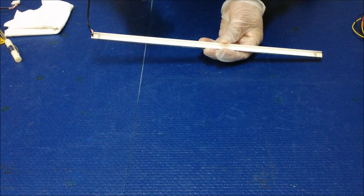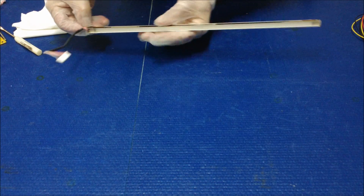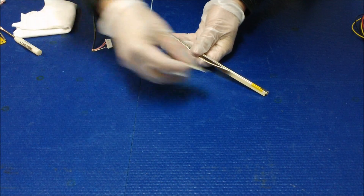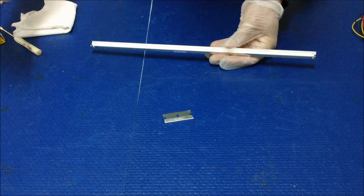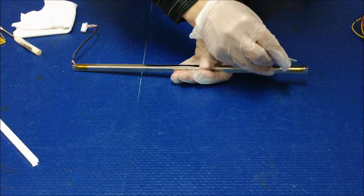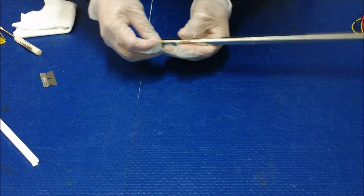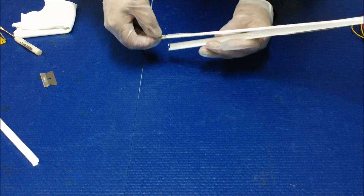We need to remove the backlight lamp — it's quite easy. As you can see, there are the wires. What I'd like to do is simply cut these tips — they're holding the low-voltage return wires — just cut them and take it out. Do the same thing on the other one: cut the tips. What I mean by 'cut' is I don't mean cut the wires — I mean cut the high-temperature tips. Slice them and take it out.